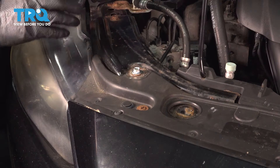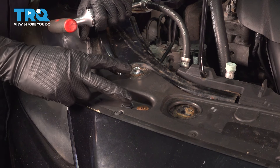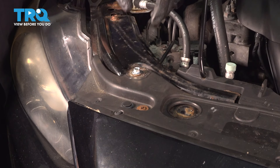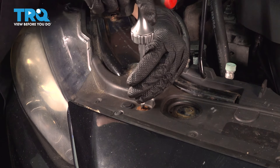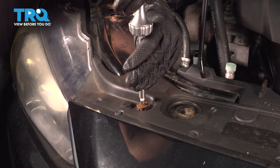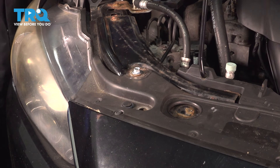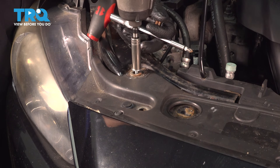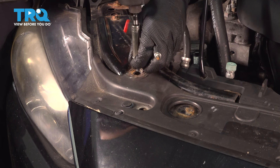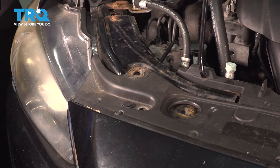On each side at the top under the hood, you'll see that there's supposed to be two Phillips-headed screws — or bolts really, they're machine threads. Mine is different here, but they're supposed to both be the same. Take a screwdriver and unthread them both. This is going to apply to both sides. This is what they look like — I'm going to have to use a 10mm on this one. A lot of times these up here get extremely rusty, which is most likely why this one was replaced. Do the same to the other side.